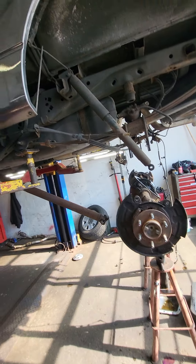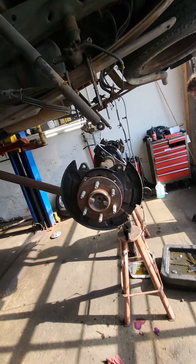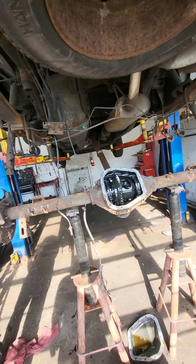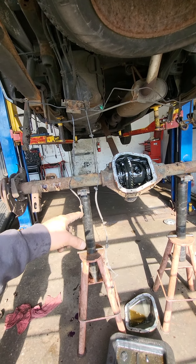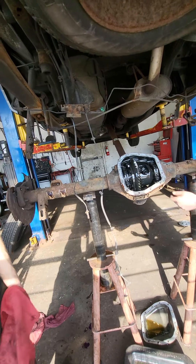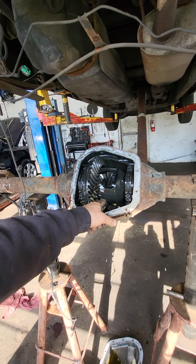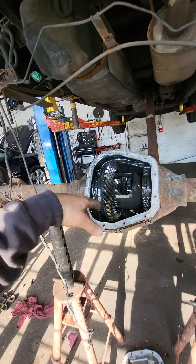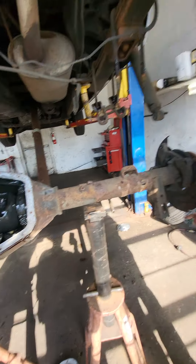Now they've got the entire rear apart and out of the car. Keep in mind that the parking brake cables were already cut and some stuff was already jacked up. So what I want you to do now is pull the pinion bearing and carrier completely out — that can go right in the scrap bin. Take the pin out, pull the axles out, and pull the whole carrier out because I want that carrier for my truck. It smells skanked.